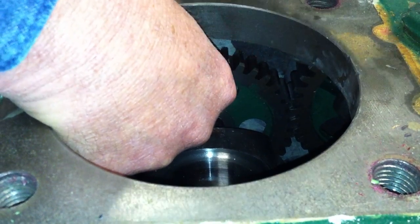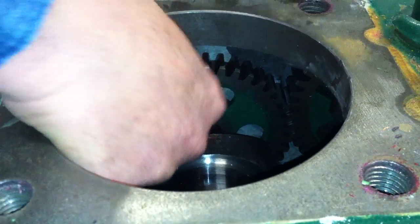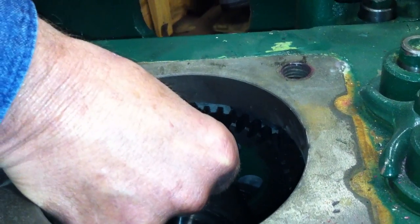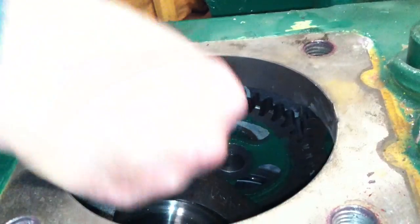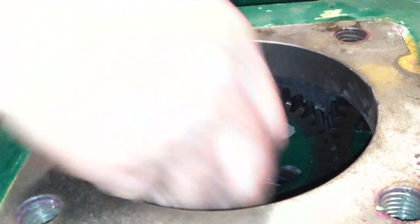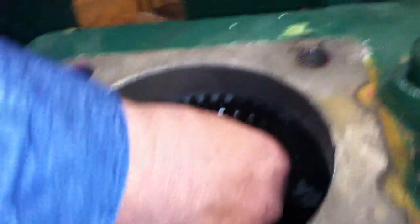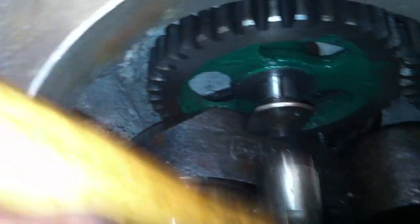You drop, you stop, and then go forward just like I just did. Now you can't get the pin in here because the crank is in the way. So hold the gear down with your thumb. Now the cam and crank are both turning at the same time. Now I can get the pin in the idler gear. I'm going to knock it in for the purposes of the video. This groove always goes up. We're going to tap it in.